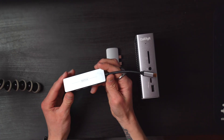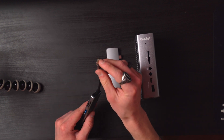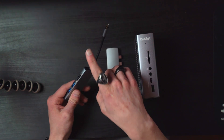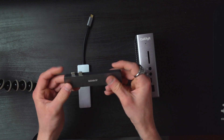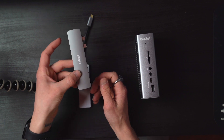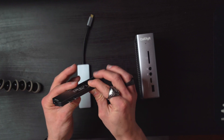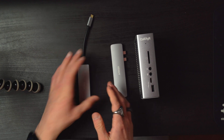The ups and downs - this cord-style dongle is going to be my favorite style for travel. Now, this one isn't a great brand and I don't recommend it - it doesn't fit very well in the computer and has dropped connection multiple times. That said, using one with a cord for travel is my favorite approach. A flush mount is very handy and convenient, however it can put strain on your laptop ports. If you move it at all, you're bending things in the ports, and weight from devices hanging off it can wear out your USB-C ports over time.